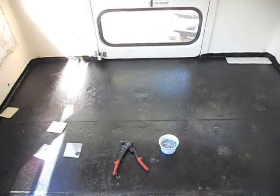And one good reason why I'm doing this is so that I'll know exactly where they are from underneath, so I can come back and rubberize them from underneath, and they should be waterproofed. That'll be good enough. I've got a lot of little bolt holes where I pulled the seats out, and I'll come back and I'll silicone them before I put the plywood in.